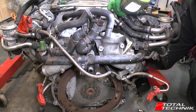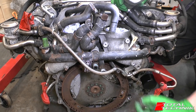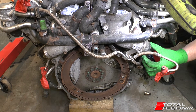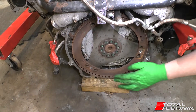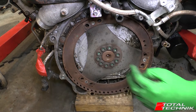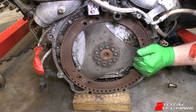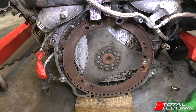Here we're looking at the back side of the engine — this is the side hidden away under the bulkhead where the gearbox connects to the back of the engine. There are the air intakes, which would lead down into your turbos. We've actually removed the turbos from this car already, but they normally bolt around the side there. Down below that, this section connects to the torque converter. You've got two sets of bolts around the outside — you actually bolt the torque converter bolts in from the back, and that's where the torque converter is literally bolted onto the crank. That turns and in turn turns the torque converter, which the gearbox uses to transfer the power.